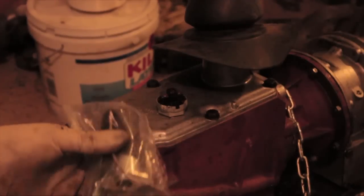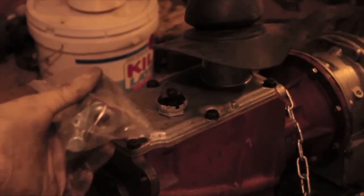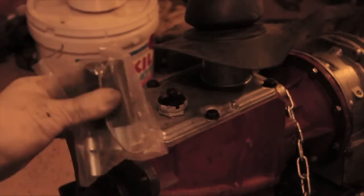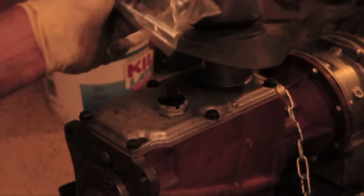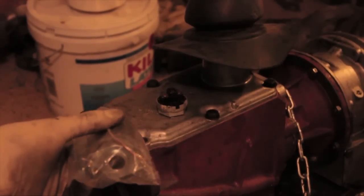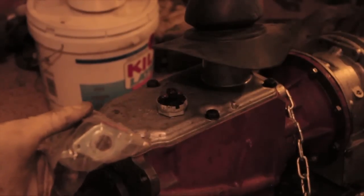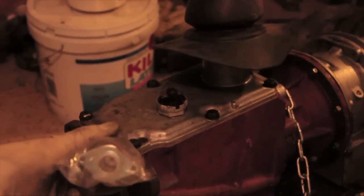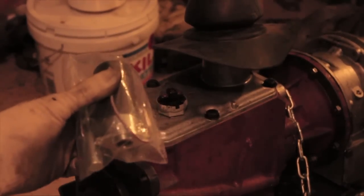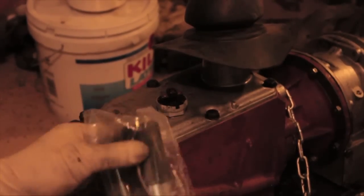Here's our 5-speed transmission with a brand new solenoid. I'm going to let you guys in on a little trick: this solenoid runs about $120 from Volvo parts retailers — the cheapest I found was $90. But I kept looking around, and it turns out that the Type D solenoid for these Laycock overdrives is exactly the same as a Type A solenoid. I found a parts retailer for old MGs and Triumphs — British cars — that had it in stock. Different part number, but exactly the same thing — listed as A or D solenoid. The best part? $34 shipped to my door.